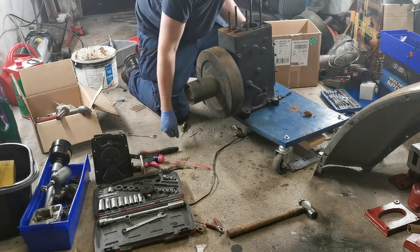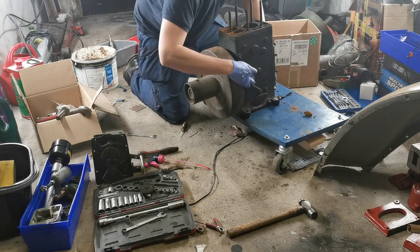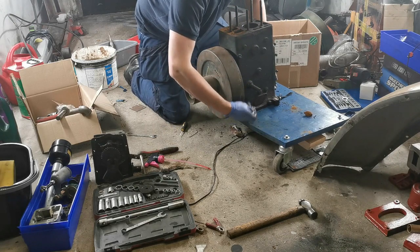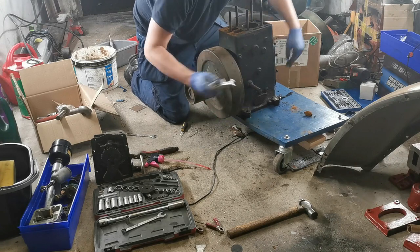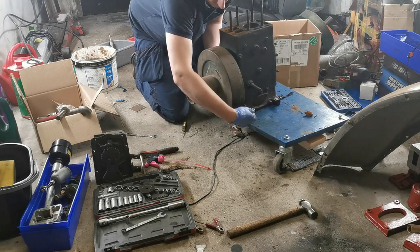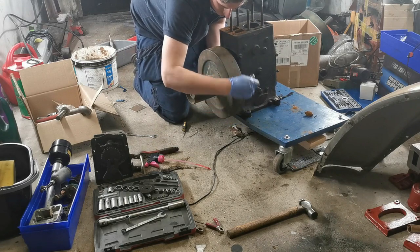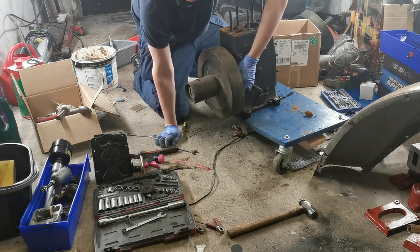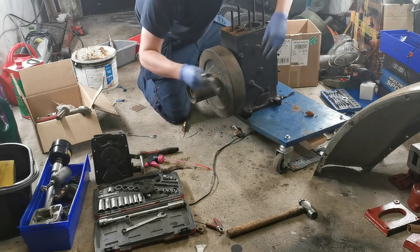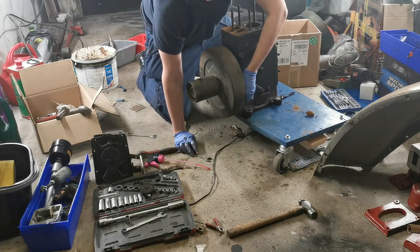There's also the drain tap that needs to be removed, and I have tried that with an easy out and it's not moving, so I think that's going to be a machine shop job. What I might do is try and shell it out a little bit first with a larger drill and see if maybe I can just remove it that way. It's kind of brass, it'll probably break up, so it'll be worth a shot. But if not, the crankcase is going to be going in for sandblasting anyway, so the lads in the machine shop will be able to do that for me too, I'm sure. So maybe I'll just go down that route and save myself the hassle. I have a new drain tap for the engine.